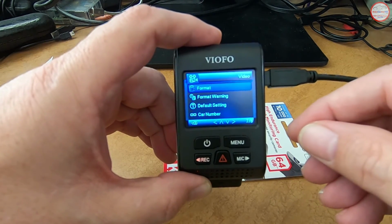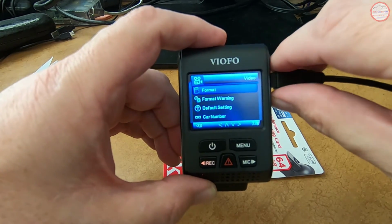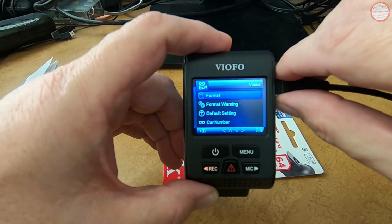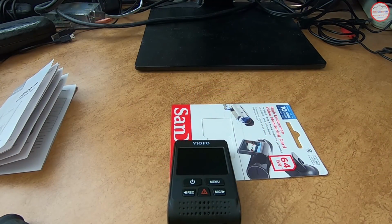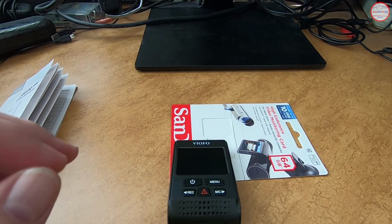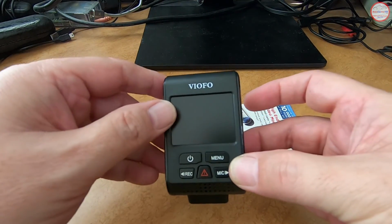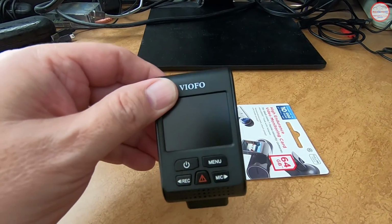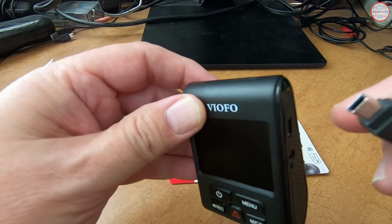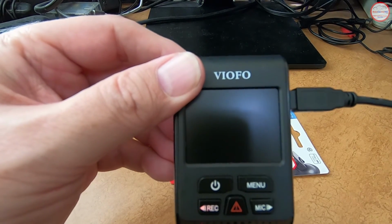With that, I'm now going to remove the power from this device, which should power down gracefully from the capacitor holding enough charge. I'm now going to connect the USB connector to the camera, but this time connected to my computer so that it will act as a remote drive, because we've already formatted the micro SD card during the untethered session where I just had a power adapter powering the camera. So now I'm going to plug it in here, and we should see it boot up after that 5-second delay.